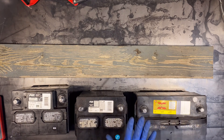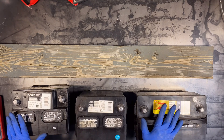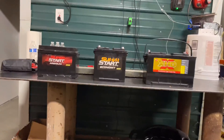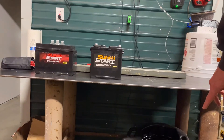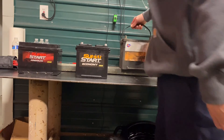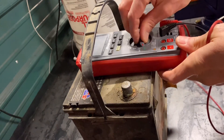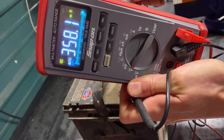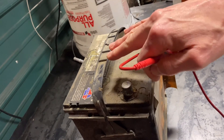This is the baseline. We're going to test this out sitting on a steel bench over a one-week period — a serious test of whether this can actually discharge a battery. Let's go a little more scientific. I'm going to put this big battery right here on the floor — this is concrete, and the original myth was to not put batteries directly on the floor. We've got another space on the bench, and I'm going to put this battery over here on the wooden block to insulate it — this will be our control group. This control battery reads 12.44. It's going to stay on the bench but insulated from the metal. We'll come back in a week and check the voltages on all four batteries.